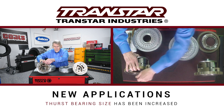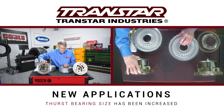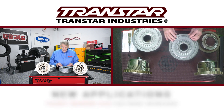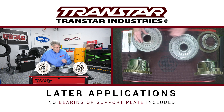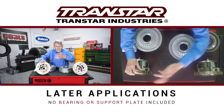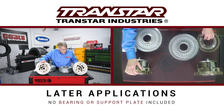They also increased the thrust bearing size down inside of it for torque capacity as well. So the new design, whether it is an enhancement or not, or they just did it for cost reasons, remains to be seen. The original applications you'll see with the bearing; later applications will not have the bearing or the bearing support plate that bolts to the front of the planetary. The front of the planetary will look like this, which is just an open window. You could actually drill this and put one of these plates in if you want to use the support.